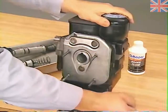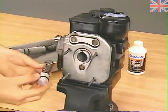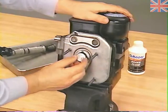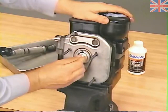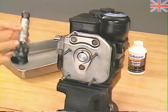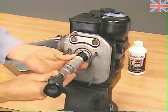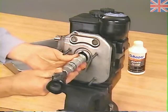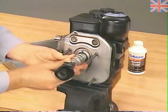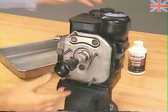Now place the hydraulic assembly back into the vise to begin installation of the new piston assemblies. Place the secondary piston, spring end first, into the opening of the actuator bore, being careful not to fold or twist the cup seals. Push the secondary piston in until the rear of the piston is flush with the bore opening. Then position the cage spring at the end of the primary piston assembly over the pin on the end of the secondary piston. Slowly push the primary piston assembly into the actuator bore. Be sure the cage spring remains over the pin of the secondary piston. In addition, be careful not to rip or twist any of the seals during installation. Remember, an internal seal leak is the problem we're trying to repair.